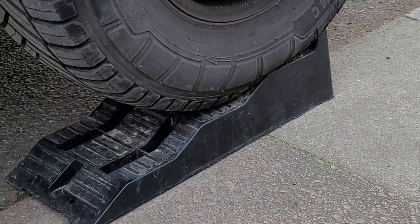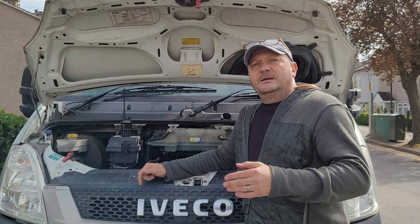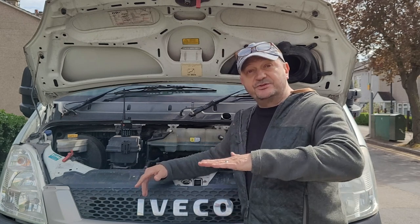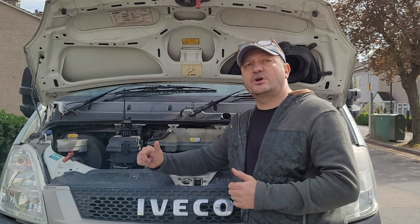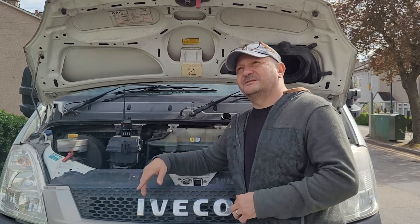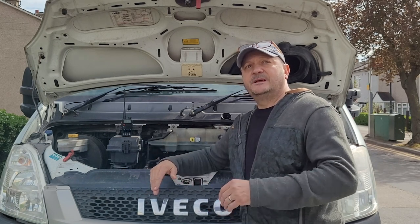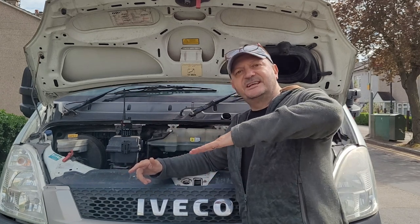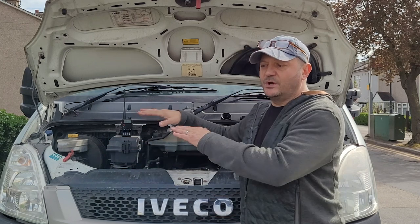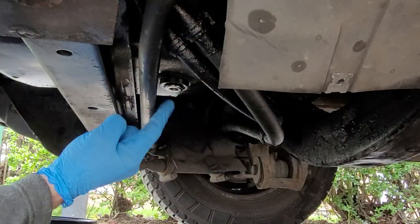To change the oil on this I go up on the leveling ramps. The reason I do that is before I started this build turning this into a motorhome camper van, the van used to sit level. But where I've removed so much heavy metal from the van and not replaced it with anything like equivalent weight, plus I've got new shocks at the back, the van sits like a door wedge. The ramps level it off so I can get all the oil out — otherwise the oil falls to the front of the pan and won't come out.